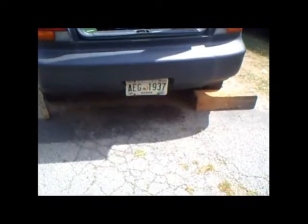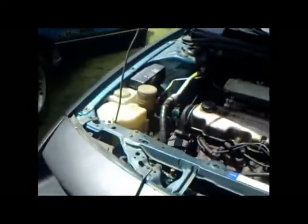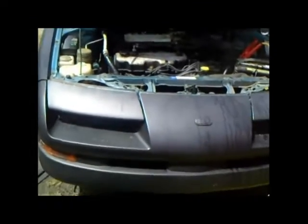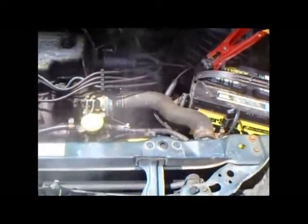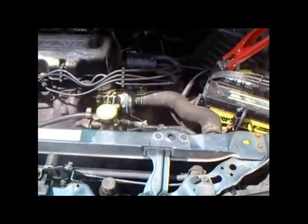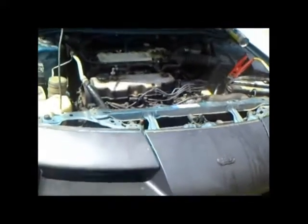Alright, about 40 minutes into letting my car run. It's stopped smoking pretty much and stopped blowing out stuff for the most part. Hopefully that's a good sign. It's sounding a little better. So skipping a little bit, knocking a little bit, but it's probably because it's got water in the oil, and if it actually works, I'll probably have to take all the oil out and everything. Had to adjust my radiator cap a little bit. It was building up too much pressure, I guess, from all the bubbles from the blown head gasket. But since I did that, it stopped running hot.